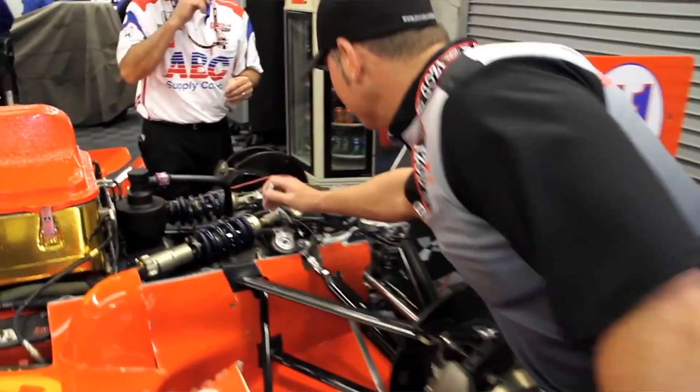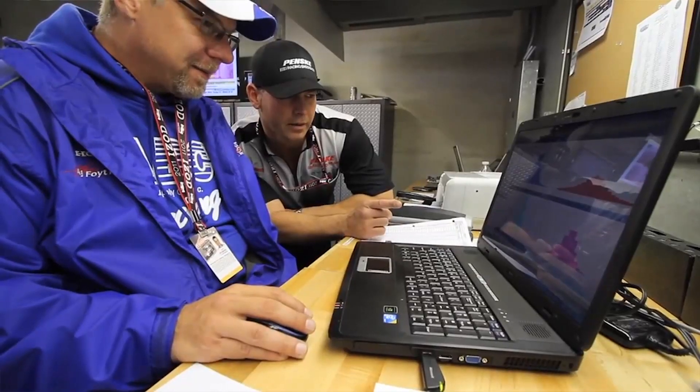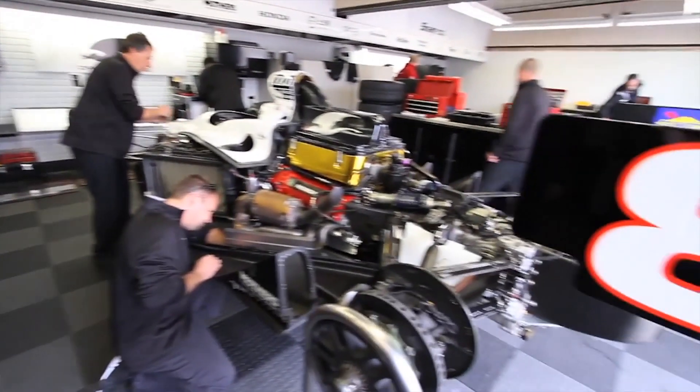You want to have the geometry where you want it so you get the most out of the tire — with camber or slip angles correct — and your spring rates should be close. At that point you can really start to dial in the shock absorbers. With all the information and resources out there, you should be able to start with a shock that's close, whether from the person you're buying it from or your own team's experience — somebody ought to be able to get you in the ballpark to start with.